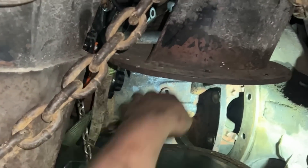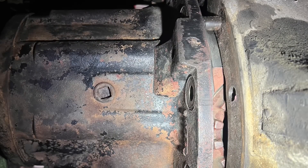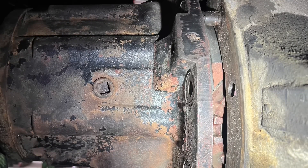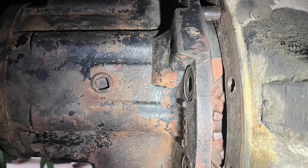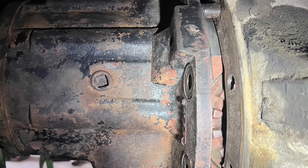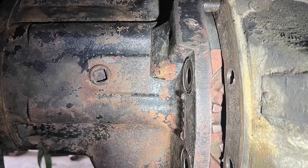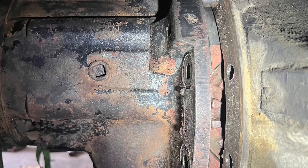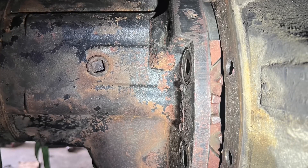You're touching on this side and I'm on this stud. Well, we got it all the way in, aligned perfectly straight, and it's about an inch away from being seated all the way — we couldn't get it to go any further. We took it out, realigned it again, pushed it all the way in, and same exact result: about one inch away and it was stopping. All the holes were lined up, it was on all the studs sliding in. We were checking left, right, top, bottom measurements making sure it was perfectly square. It just would not go in.